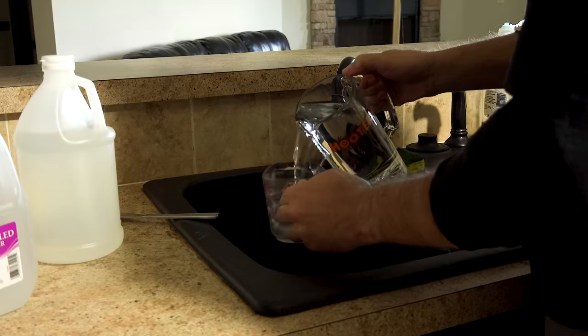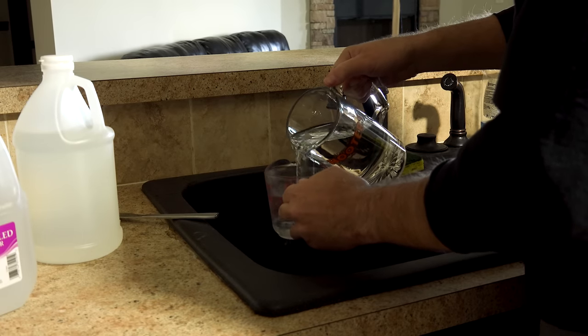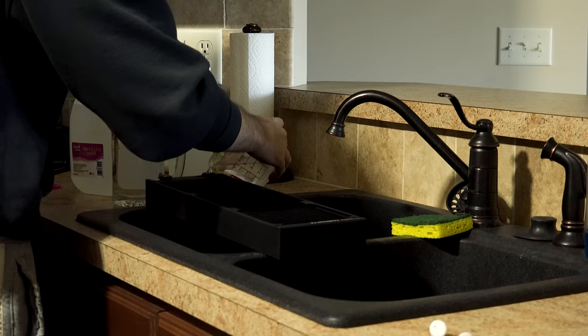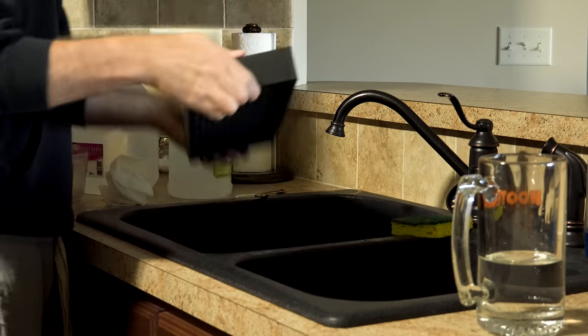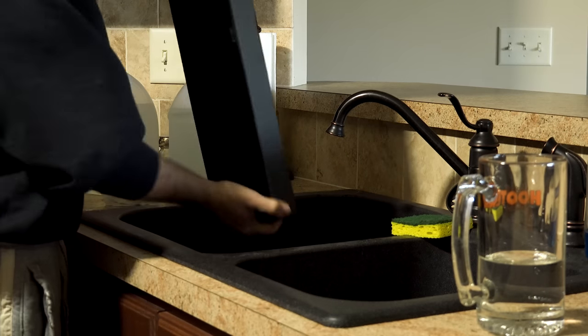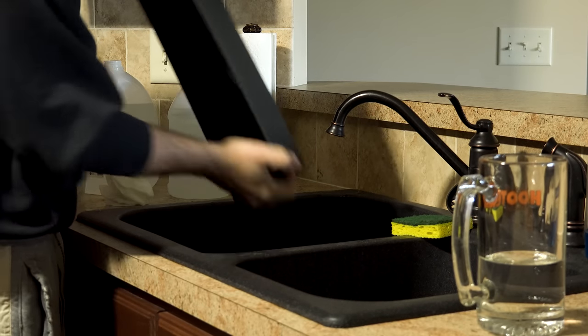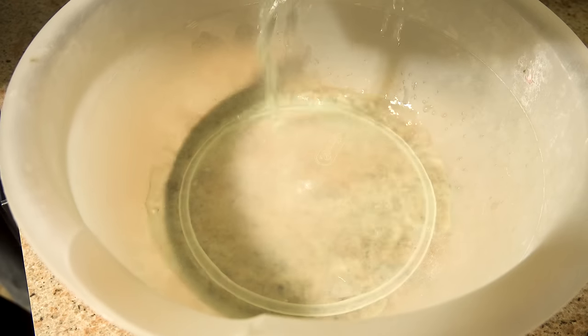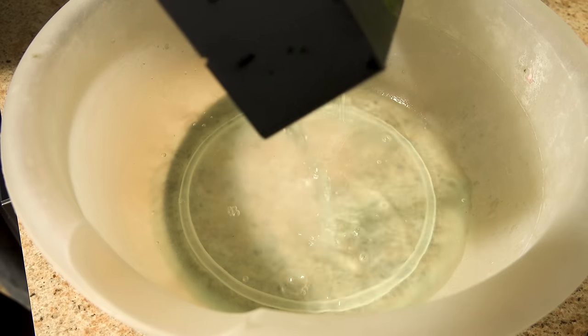And then I flushed the radiator 5 times by filling it about 80% full, putting the caps on and shaking it vigorously to shake loose anything that was left over from the machining. As soon as I was done doing that 5 times, I then flushed it 5 more additional times with regular distilled water.